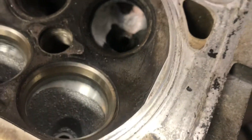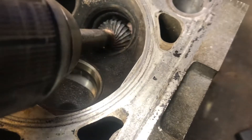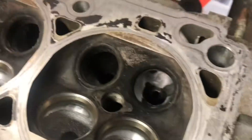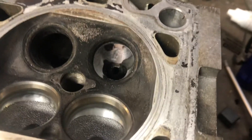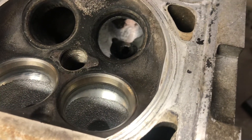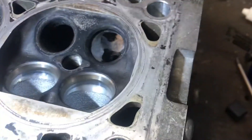I usually go around until the tool touches the valve guide slightly, then I turn the head around and come from the other side to blend the port from there — going over the guide, because it's easier to cut from that direction. When you're done, you have a nice port. You can then take a flapper disc and polish the port if you like, though it doesn't make a huge difference since it'll be caked in exhaust soot anyway.